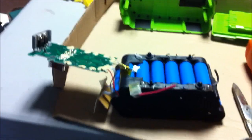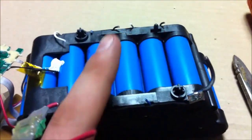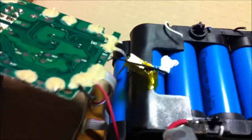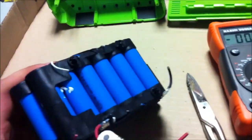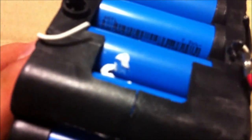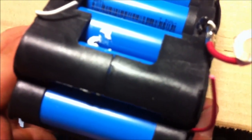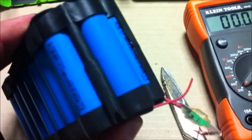To take the board off I had to cut pretty much every single balance wire off of the 40 volt pack. Flipping it over you can find the little temp sensor stuck down in there. It's 20 cells of 18650, and you can just make out the label — it says ATL 7.5 watt hour INR 18650 P201, with another number on the right side: C9520835E790.